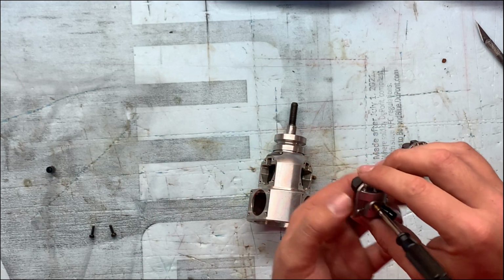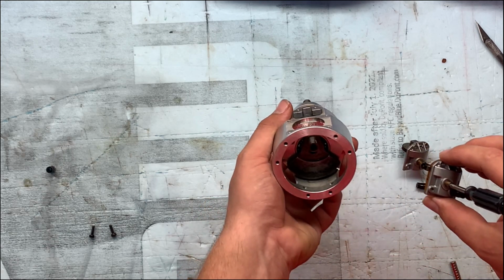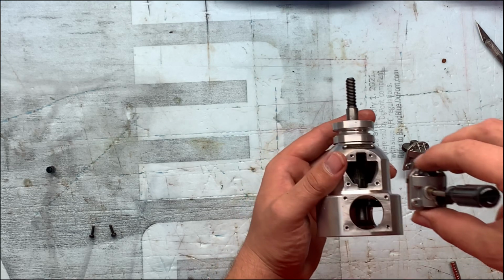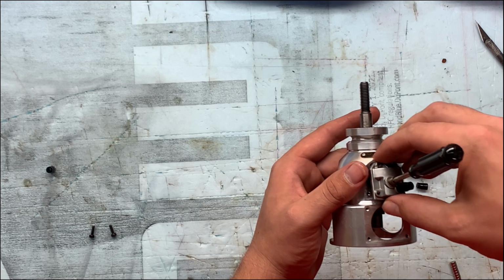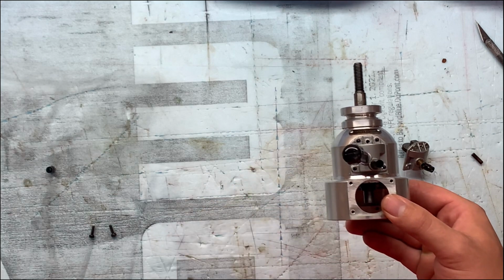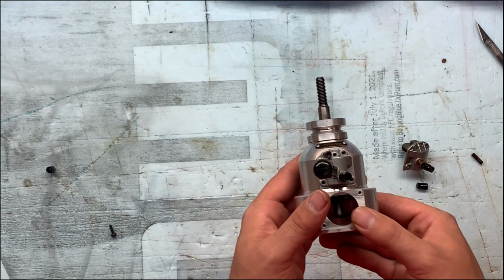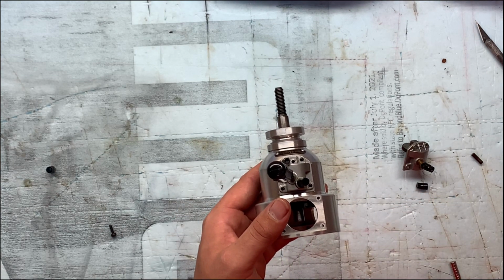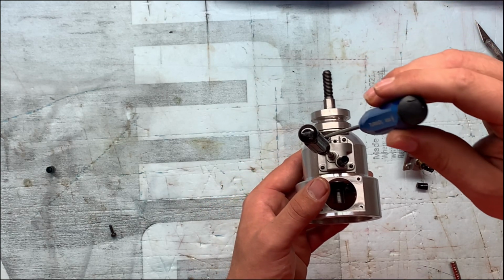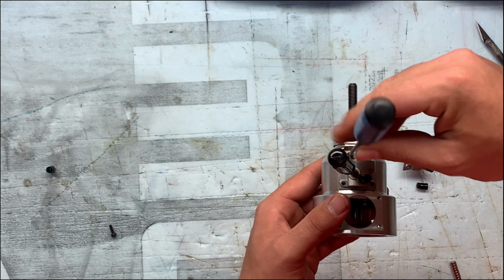So you see it can't move. Let's see if we can put this on. All right, top dead center. Yep, right there. We'll go ahead and plop this on, just like that. And while this screwdriver's still in here, I'm going to put in a couple of the cam cover screws. Not all of them, though, because we want to confirm that this thing is timed correctly. I'm just going to put in 2 to hold it in place right now while we time the other cylinders.